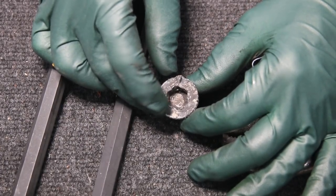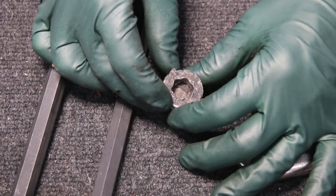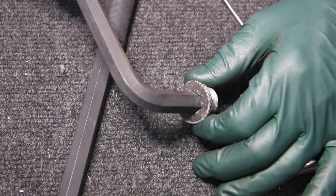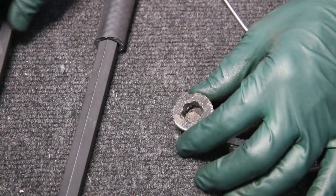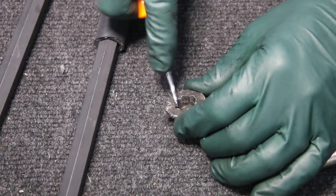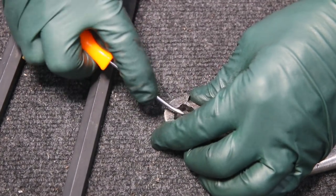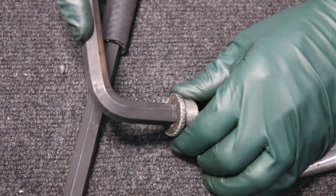I'm going to explain how I was able to get it out. Look right in here — you can see that the wrench was probably only inserted part way into the hex. The first mistake this person made when trying to remove this plug was not cleaning out the base. Look at the crud that has built up down in there. You need to get that all out with a pick tool and make sure the hex wrench is seated all the way down to the bottom.